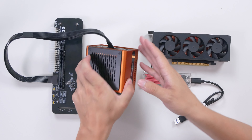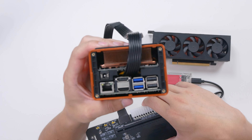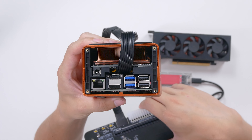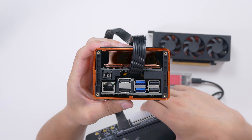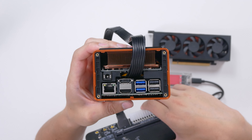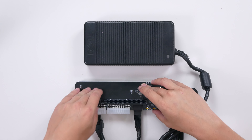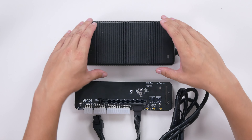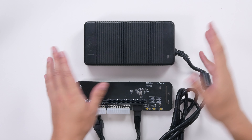This A2000 has also been shunt modded so we can push more power into it. Taking a closer look at the dock connected to the Shulu XR1, I had to modify a few things. I had to cut the H-frame on the XR1 that basically houses the two motherboards, and I had to cut a small piece away to make an opening for the cable for the eGPU dock. Next, let's take a look at the power supply required to power the R3G ADT-Link eGPU dock.